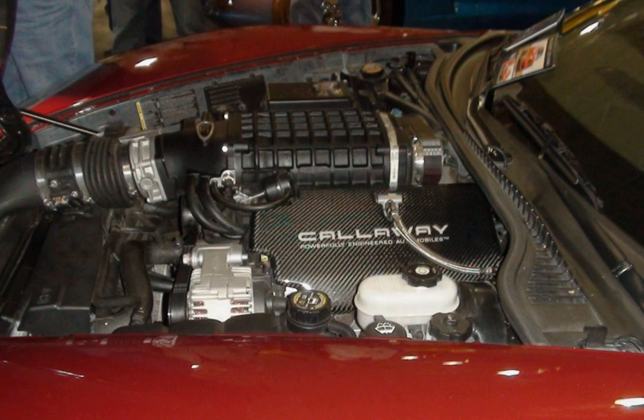Inspired by the LS1 in size and performance goals, the 4.125 in bore family of blocks was designed for race-oriented performance. The only engine with this bore size used in a production vehicle is the LS7, with the LSX being only for aftermarket use. One unique feature of this family is that the cylinders are Siamesed — no water passages between neighbouring cylinders — to increase both bore size and block strength.